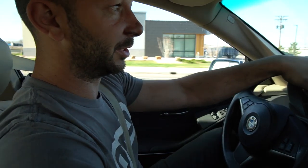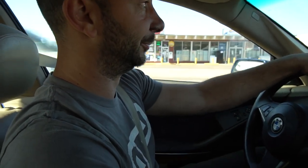The big thing leaking on this right now is the input seal on the diff — the pinion seal. It leaks a lot of fluid out of the front where the driveshaft connects, and I don't really want to damage that diff so I haven't been driving it much. The E39 M5 is also leaking in the same place — I ordered the seal and it's the exact same part number for both diffs. So that will be a how-to on replacing your pinion seal in a BMW. Thanks for watching — I hope you enjoyed this video where we built a BMW E63 from stock to something pretty capable.